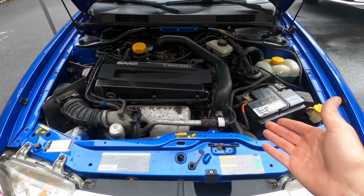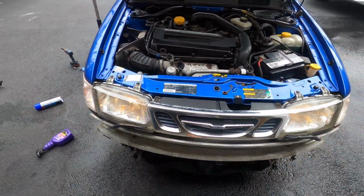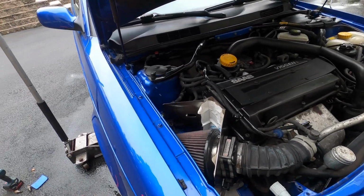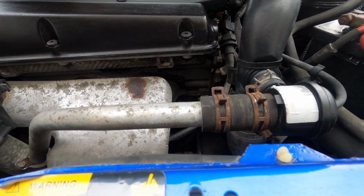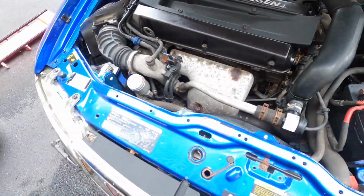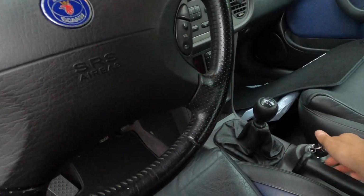Accessory fans are working. The AC is not running right now, but like I said, it's been sitting and running to dry up. Sounds amazing in there. I'm gonna turn it off momentarily. Obviously there's enough oil pressure to cause a leak, and as you guys can see there, we're not leaking anything. Everything looks really dry all around this valve cover, so that's a good thing. I'm gonna order the exhaust because I just confirmed what it needs, and I'm gonna turn this off for now.